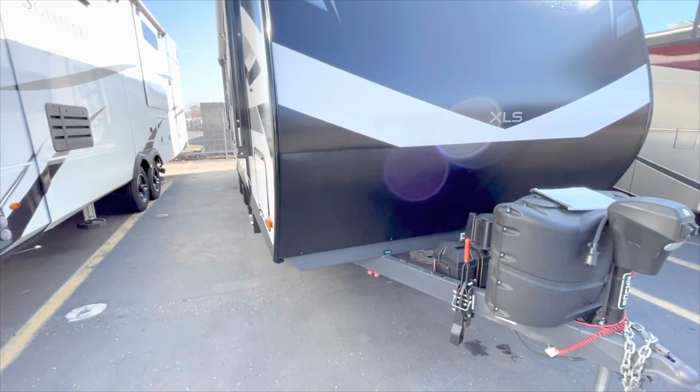You can see how yellowed the sealants are. I'm looking for gaps or missing voids in the sealants and checking if they went all the way around in the compartments. I checked up on the roof — the roof looks in pretty good shape, with a couple of questionable areas, things that aren't tight or sealed. I can see where this window rubber is starting to pucker. I tried to pop it back in place earlier but it's just shrunk too much. It can be cleaned and glued back in place.